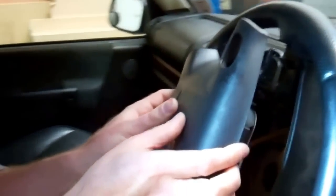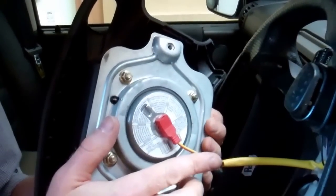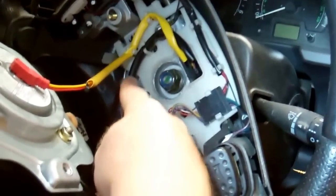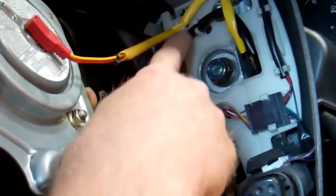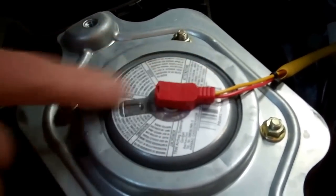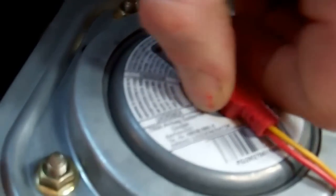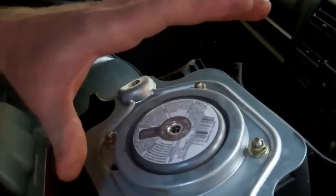Now gently remove the airbag — don't move it too far because it's on a fairly short cable. Note the cable orientation: the yellow cable goes through the two outer clips and the black cable runs through the inner clips. Also note that this connector is pointing towards the little slot here — make sure you put it back in that direction. The connector just pulls off; it can be quite tight with no special catch.